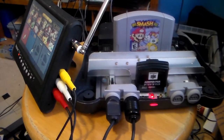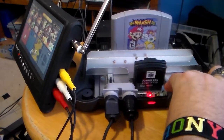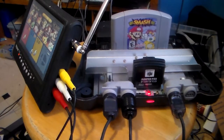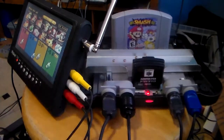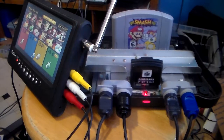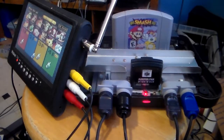This is my gold super pad controller. Then grab another controller — let's grab the clear black one, since I do have a smoke black system — and plug it in to see if it works. Sometimes if you wiggle the controller ports it will disconnect. Grab Player Four and be sure that works too. All four controller ports are working. It's a good idea to always check that the controller ports are working before you put it all back together, or to see if the expansion pack is working. If it isn't, you'd have to open the case back up, which is a bit of a hassle.